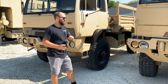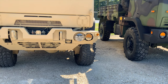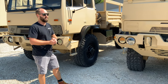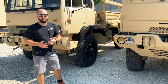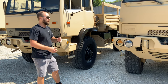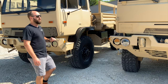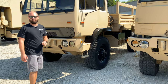Headlights are the same across the vehicles. We offer Truck Light OEM headlights as well as a headlight we manufacture ourselves — all LEDs are 10-through-32 volt, so they'll fit in other vehicles like a Jeep as long as it's a seven-inch round bucket. One important thing: we get a lot of calls from people saying they found Jeep headlights online, but those typically have an H4 pigtail and do not have the correct military Packard pigtail connectors required for plug-and-play installation. All of our headlights come with the correct Packard pigtails, and if you have H4 or H11 headlights, we also offer adapters.